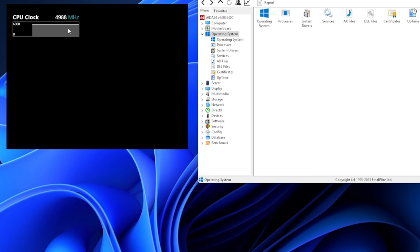Now obviously this megahertz text here — if you want that to be teal you can do it that way. But here's the reason why we just spent so much time on getting this one going: let's say now we want to do a GPU. We can right-click and say Copy, then right-click and say Paste. Now we can click Move and put this side down here for GPU. So now we'll right-click, Modify, and we'll make this our GPU clock — so here's our GPU one clock, hit OK. This is my RTX 3080 Ti that's in here right now — so now you can see it says 'GPU one clock 1320.' We can just name this RTX 3080 Ti, and same thing up here we can make this now say '12900K.'